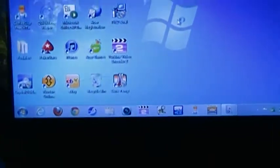Yeah, let's start up some of our browsers here because I think I have to update a whole bunch of them. IE9, I know I don't have to start up because it doesn't automatically find its own updates. And I'm going to start the task manager here. We're already using 78% of our physical memory. I'm going to have to put more RAM in this thing. Although I don't know with this BIOS version if it'll accept 2GB sticks, because I read on the internet that one of the reviewers said that they couldn't get it to power up with a 2GB stick in it until they flashed the BIOS. And if I can't get it to power up with a 2GB stick, then, well, screw that.